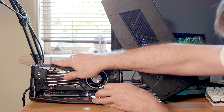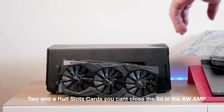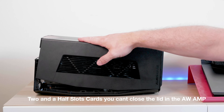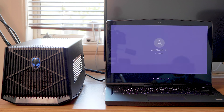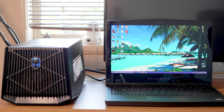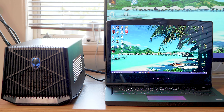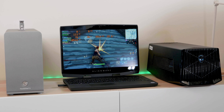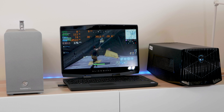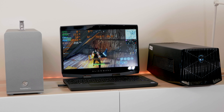At the end of the day, that's why the Alienware graphics amp is so much faster — it's just a direct port giving you four lanes straight into the GPU with no overheads, giving you all that bandwidth. Whereas the eGPU uses Thunderbolt 3 with all those overheads. It doesn't matter the length of the cable or how far from the CPU — Alienware's three-meter cable still has more bandwidth than a Thunderbolt 3 eGPU. If you want the easiest eGPU with the best performance, the Alienware graphics amp is hands down the best external graphics amplifier.